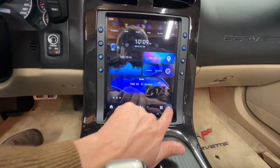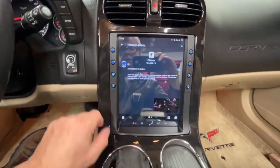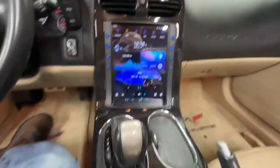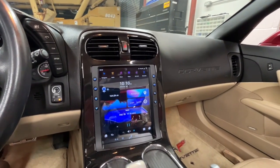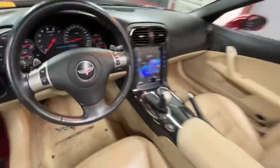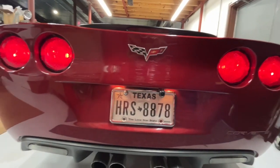That's a basic look at it — I'm a first-time user so I'm playing with it not knowing everything. I didn't know how to install it before this but it was very very simple. We're a shop here and this was very simple — home users can do this with just the basic video. The hardest part honestly is just the camera in the back for the backup camera, which is the same as any backup camera install — just one RCA wire hidden back there. We have it positioned where it's easiest to mount on this car without cutting any holes, using one of the screws for the license plate lights.